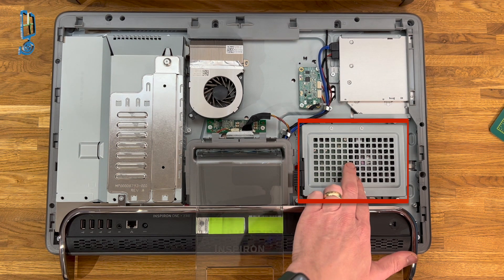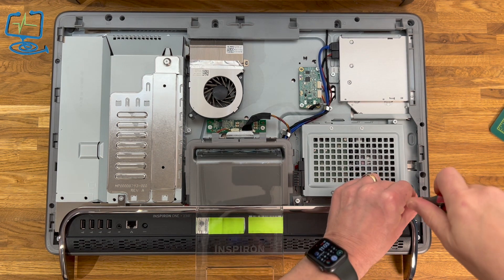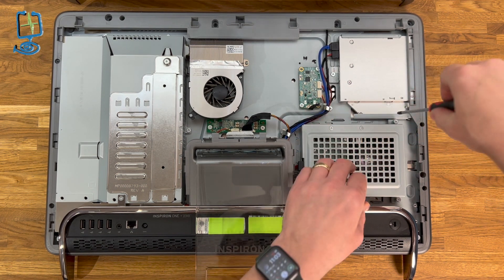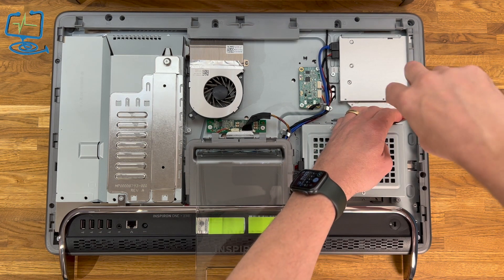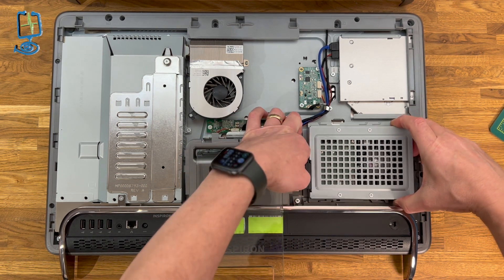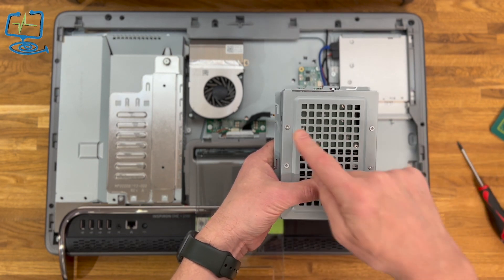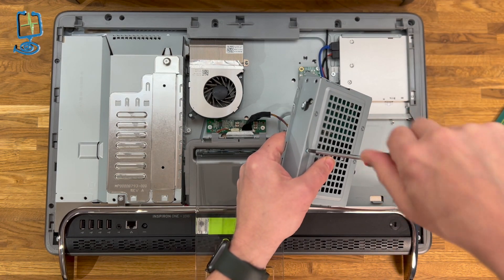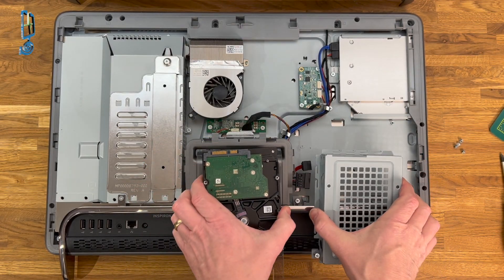On this particular machine the hard drive is on the right-hand side underneath the case, and the RAM is on the left which I'll show later. We need to release the hard drive from its casing. There are two screws — they are spring-loaded but retained on the case so they don't come out. Release the two screws and the whole lot slides away. The cable is tight so you just need to wiggle the data and power cables out.